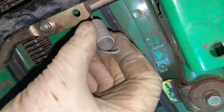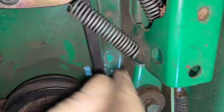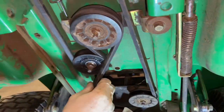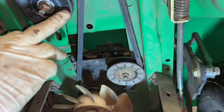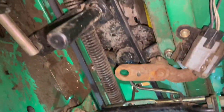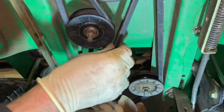The spring goes in the other hole — I remember when I took it off the spring went this way, so I'm going to put it in there like that. I think I can do this by hand, it's not really that difficult. Now everything is very close as far as how this belt is, but nothing rubs anything. When I get it on the ground and run it, it'll probably straighten itself out. Just make sure you're not rubbing against everything, make sure you have everything in line. Check your pulleys — this pulley was good, this pulley is actually new, because the old one was bad. We did that pre-video. Make sure you check your pulleys before you put the belt on, and that's pretty much it. Please feel free to leave a comment, give it a thumbs up, subscribe, and thanks for watching.